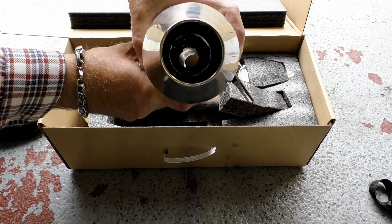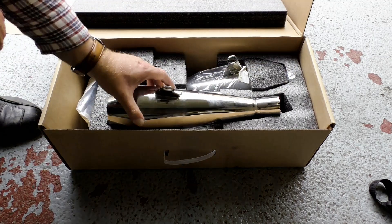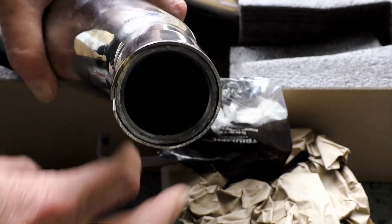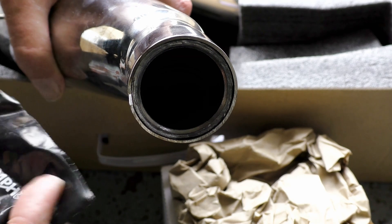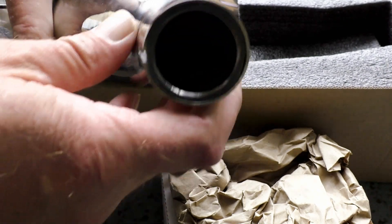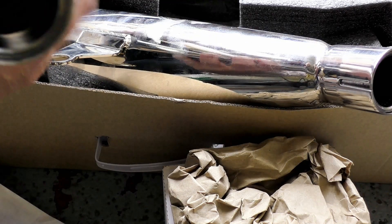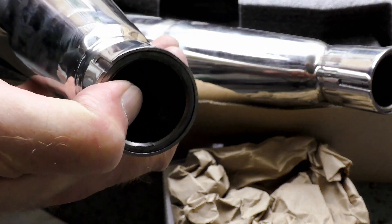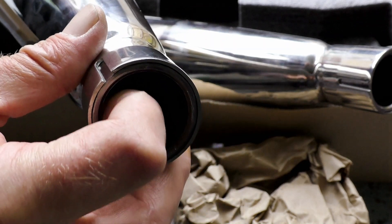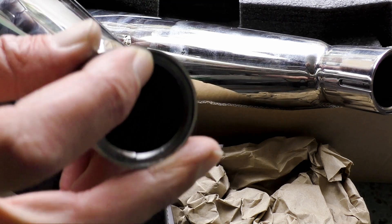This might also be helpful for people changing from the standard Triumph silencers, as removal is very slightly different from removing the Sleeper Pros. You are going to need a set of graphite exhaust seals. These don't come with any of the British Customs kits but you can buy them separately either from British Customs or from your local Triumph dealer. I have heard of people fitting these silencers without the graphite seals, but I can't imagine how those people managed it and obtained a decent fit — I just don't see how it can be done.